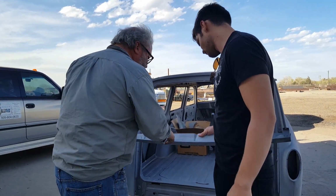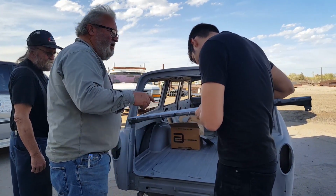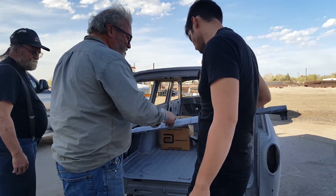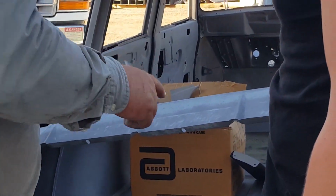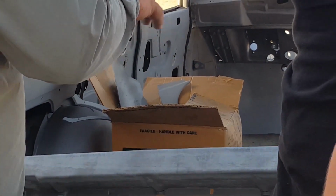Yep. And so what you can see is the galvanizer. If you flip it over, you see where all this is right here? That was underneath the coating that we took off. And so this part here, galvanized and giving up its electrons. And this stuff here, it didn't have to because it was still underneath it. But that's why there's a couple of pieces in here that are galvanized.